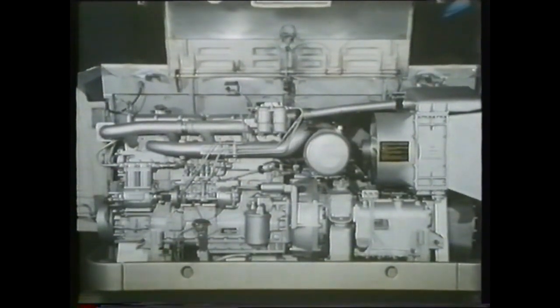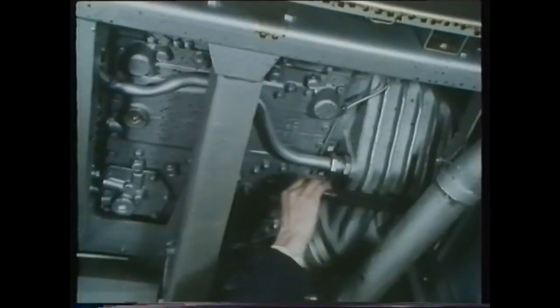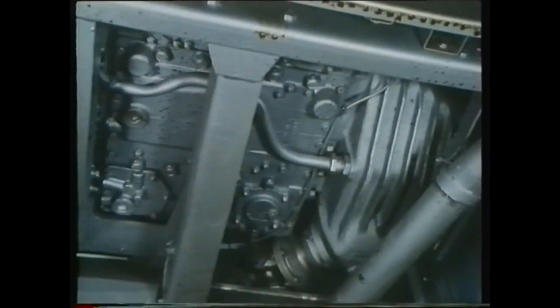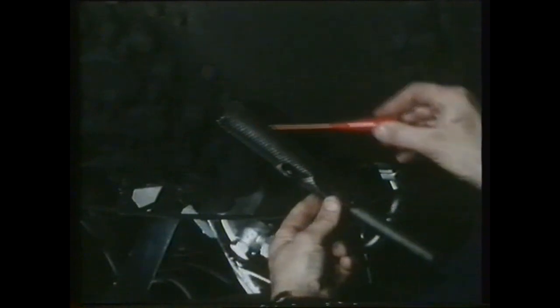On vehicles that have a charged flywheel, a major oil leak would again be obvious on exterior inspection. But the other fault condition that would cause a no-drive situation on a vehicle that has a charged flywheel is where correct maintenance hasn't been carried out and the internal oil filter has become blocked to cause a starvation of oil to the flywheel. On the Atlantean, oil is taken from the angle drive through an internal filter and pumped to the flywheel. A Leyland National has a charged flywheel and the oil for the flywheel is drawn from the base of the gearbox through a fixed internal filter. Here is the filter and since it's at the base of the gearbox, you can establish whether it's clear and passing oil to the flywheel by releasing the lock on the pipework that goes from the gearbox to the flywheel to check for a free flow of oil with the engine off.